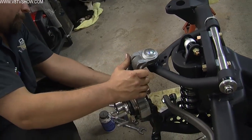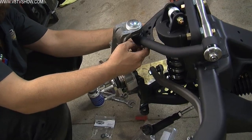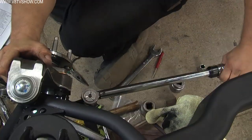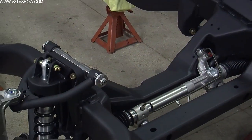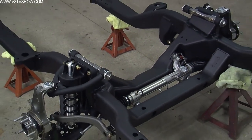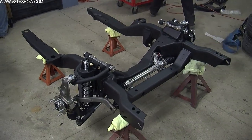The next thing I did was to install the pre-assembled Corvette spindles. The upper arms and the spindles installed just like any other subframe — just bolt them on, bolt the ball joints down, put your cotter pins and you're ready to go. Now that we've got the subframe assembled, the next thing is to test fit the motor and the headers, and bolt this all to the car to see where things are going to land so we can plan the rest of the build.